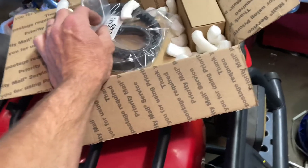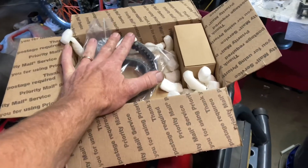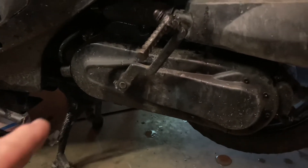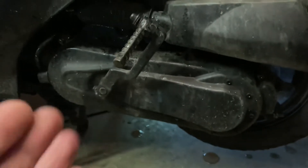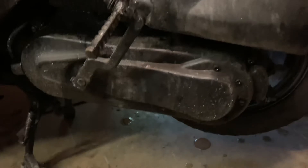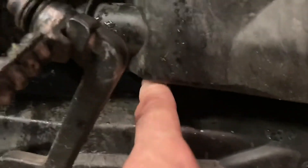I think that's actually the wrong case — we're about to find out. Anyway, we're going to take this off and go through a few things about what's going on with these transmissions. On these side covers, on the 50s the kickstart is attached to this side so you don't have to pull it off. On the 150s you actually have to pull the kickstart off because it's attached on the inside. A bunch of eight-millimeter bolts — they're all throughout the bike. On the bottom there is a drain for your carburetor on that hose.